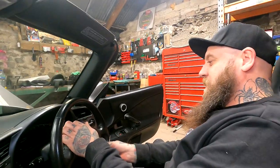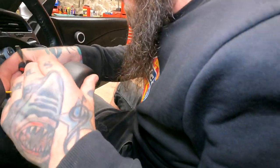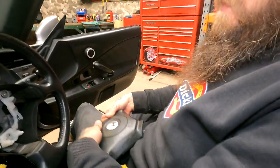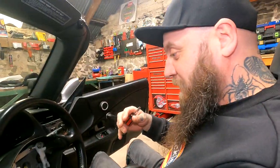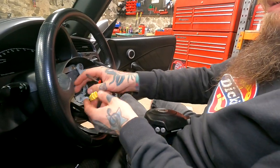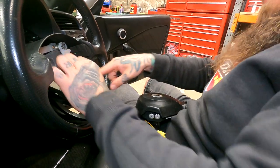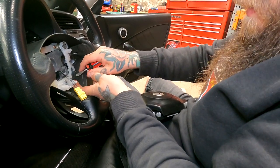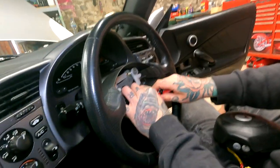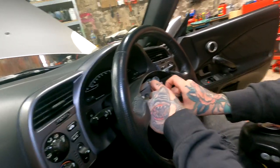Right, so they're out. That's it. Should just come in here. That's your airbag out. That, I'm assuming, needs to come up through the hub. Yes. And that middle one, that one there's got to come out. Your centre one would be a 17mm, I think. I think it's a 14. A 14? Yeah. Right, so that's your horn.